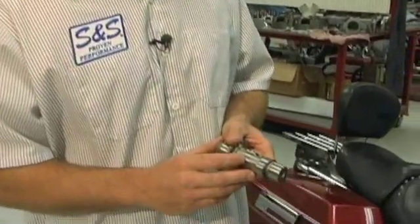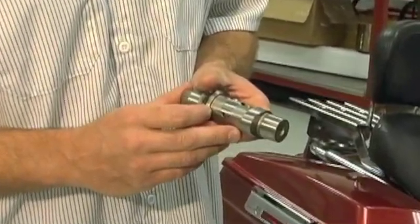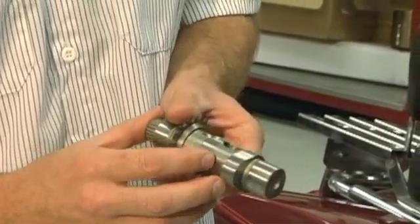We've tested it — it's unbelievably strong. We've got testers out there with 50,000 miles on it, not a failure at all. We tested the heck out of it. We put together an automatic starter that every 40 seconds it starts the bike, it runs for 20 seconds, then it stops and cools down for 20 seconds. We would start this Monday morning and ran it through Friday night, 24 hours a day.